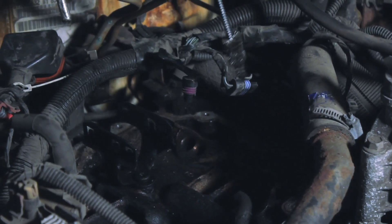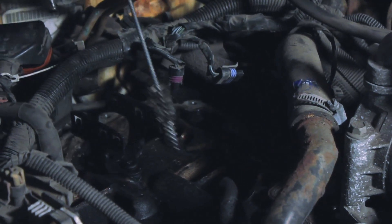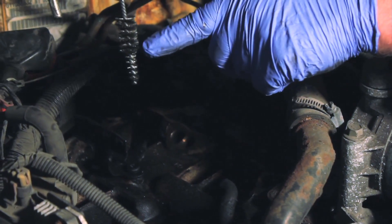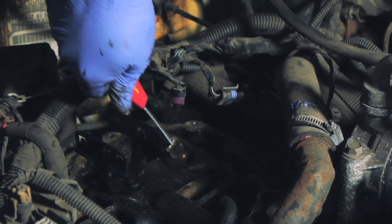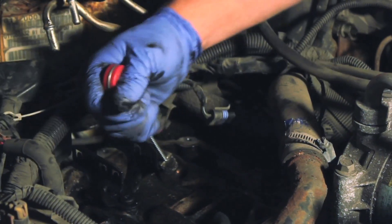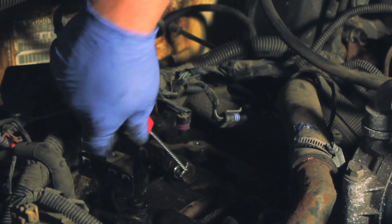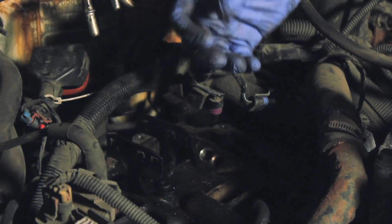Now that we've got the old unit removed, we're going to do a little cleaning which will aid in the installation of the new unit. You'll notice there's a lot of grime and carbon build-up in these passages. We're going to use a small two-step brush — it's got an inner narrower piece and a broader outside, which works perfectly inside the bore. If you don't have this tool, use a pipe cleaner or a rag over a screwdriver — anything to clean out these ports and remove the carbon. We want a nice clean surface to slide the new injector in. When done, take a shop vac and vacuum out any debris to make sure nothing goes inside the engine.